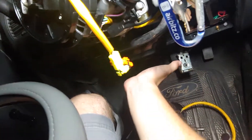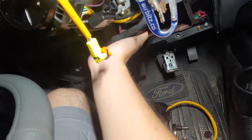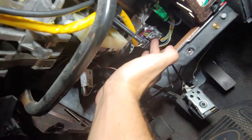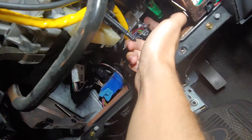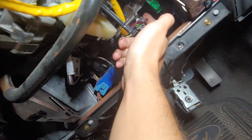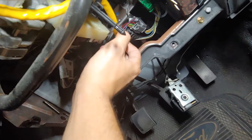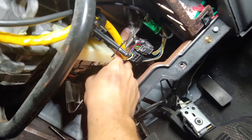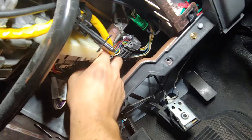Since this connector is permanently attached, you're going to have to remove a plastic panel — I think it was seven or eight millimeter bolts — and then there's also a metal panel to remove. That gives you access to the back of the yellow cable. The back of the yellow cable has two connectors; don't try to undo it from the front and pull it out, because the plastic that mounts onto the frame is all part of the new clock spring. Remove the car connector back there, and then there's a grounding connector — a 5/16 bolt — undo that bolt and you have the grounding connector.